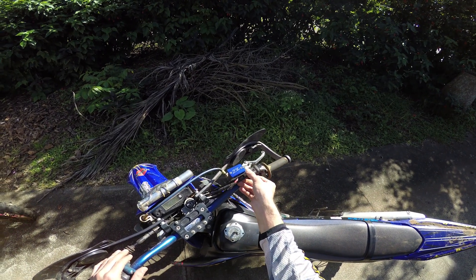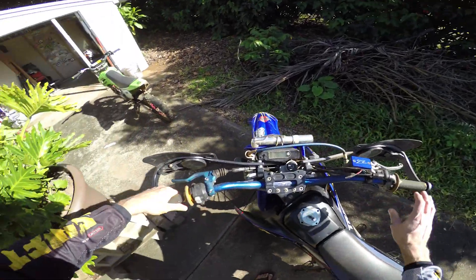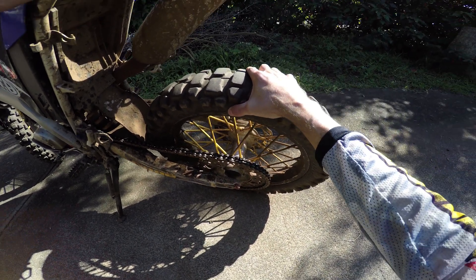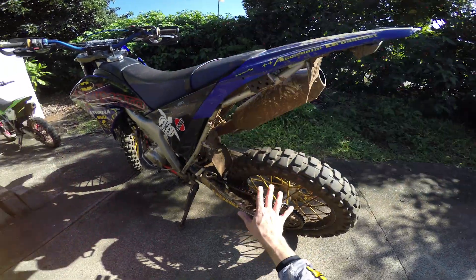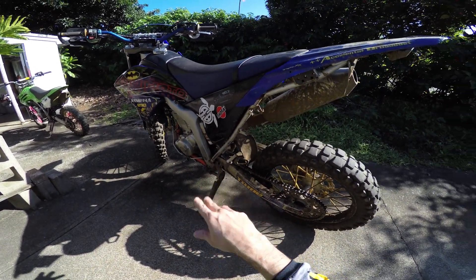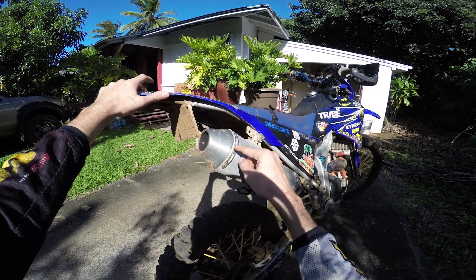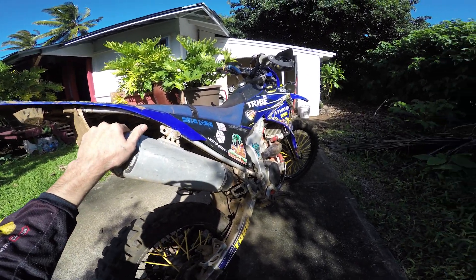My starter switch has been out forever, so a new one needs to be installed — that's easy, plug and play. Grips are okay, they kind of swirl around so I might change them. The rear wheel bearings are going out, so I need to change those pretty soon. The chain is alright — it just needs to be cleaned up. Rear sprockets are good, need to be oiled. Front sprocket might need to be changed soon — the teeth are starting to widen up. Regular oil changes and all that. This muffler needs to be repacked badly — I'm guessing I have to drill out all the rivets and repack it, then re-rivet or bolt it. If you guys comment below about how to repack an unserviceable can, I can use that technique.